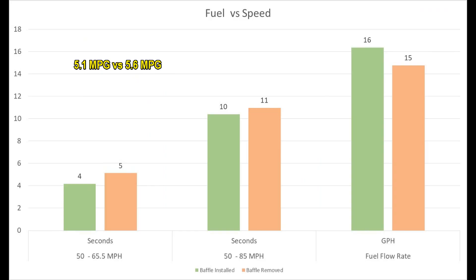This is probably one of the most interesting charts — the effect of limiting the amount of air. You're basically de-rating the engine, so the engine gets better miles per gallon, but at the cost of performance. From 50 to 65.5 mph we're about a second slower; going all the way up to 85 mph, we're still about a second slower. It's not a drastic difference but it's definitely a difference, and it repeated eight times in a row so I'm confident in the accuracy. Look at your gallon-per-hour — pretty significant at wide-open throttle, about 15 gallons per hour.